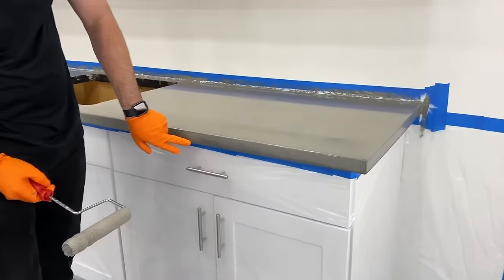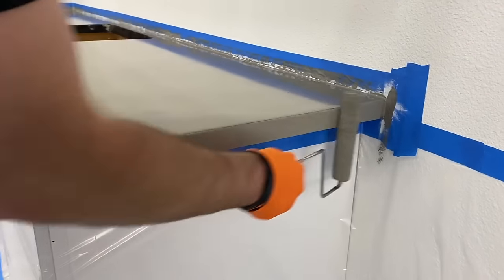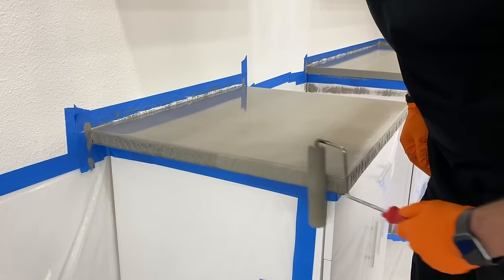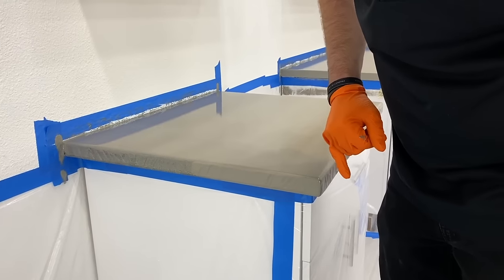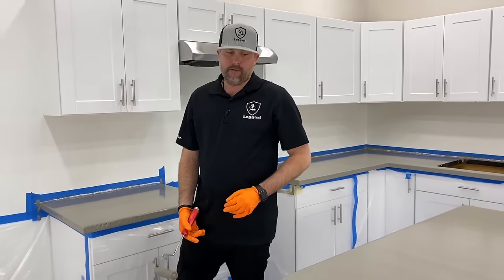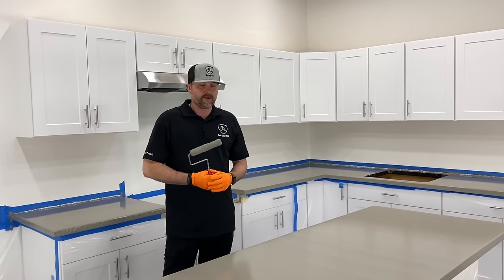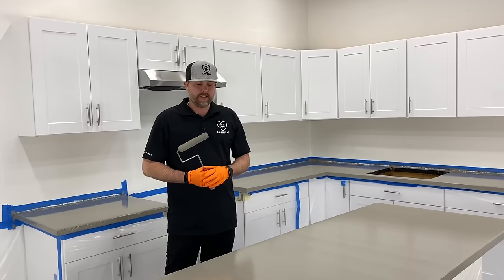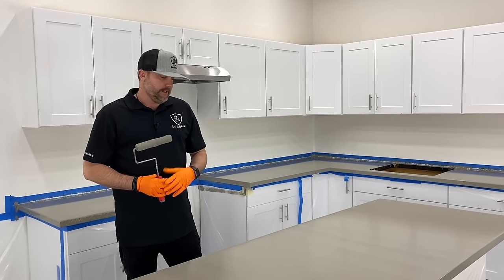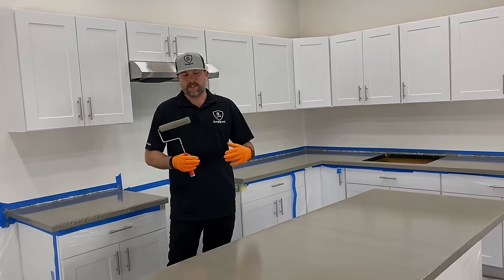You can see how fast it dries — this is already ready to go. It looks wet versus dry but it's already getting tacky so I can just hit it again. This one I just finished so I need to let it sit a little more. We'll let that tack up about five minutes. If you can get some airflow on the primer without blowing dust on it, it's going to dry even faster. We'll put a fan on this and probably start the epoxy about a half hour from now. The primer dries really quick and is easy to do — two coats. Main thing: make sure your edges and faces are as solid a color as possible.